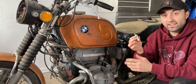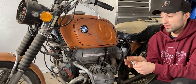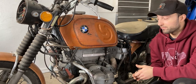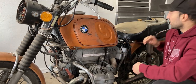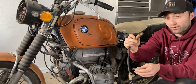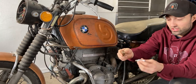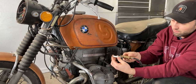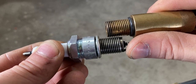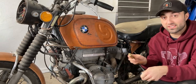I took the spark plug out and I didn't have any issues whatsoever. Everything seems to be just fine and it looks like this spark plug is brand new, so the gentleman I purchased this off of must have just replaced the spark plugs before I bought it. Now I can go ahead and thread in the compression tester gauge. I will check the pitch and the thread size before I thread it in — the best way to do that is just grab your compression tester gauge and hold it up right next to the spark plug. The pitch of the thread and the diameter of the thread should be exactly the same, and if everything adds up then you can thread it into the cylinder head.